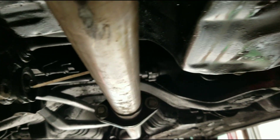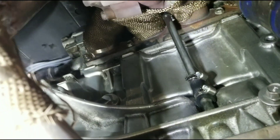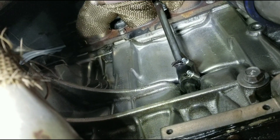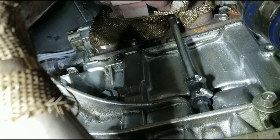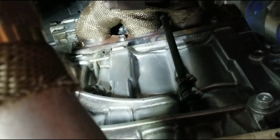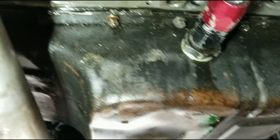She's got the dipstick clamped down — haven't seen that one before. There are some more oil leaks up there, looks like they're coming from either the head gasket or the valve cover dripping down, could be the exhaust chambers too. That's gonna be a big thing I want to look into — if he's getting oil inside the spark plug area or combustion chamber, that's definitely a big deal, so something to look into.